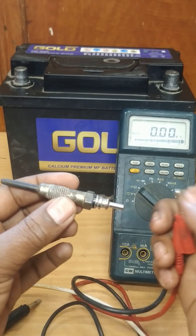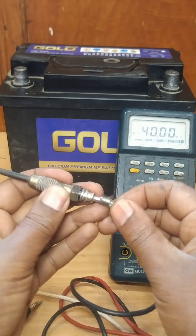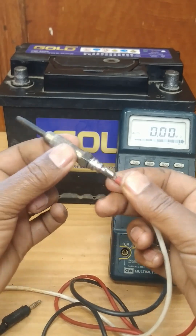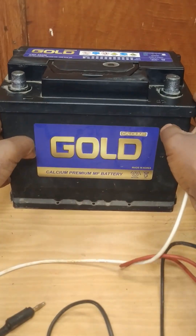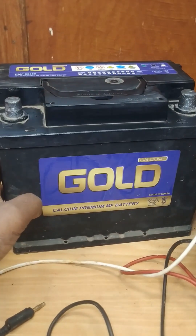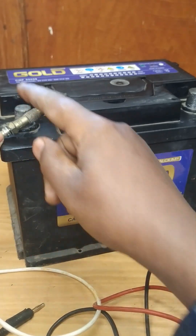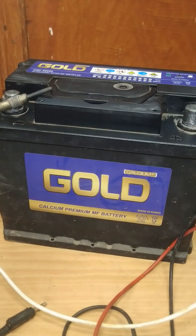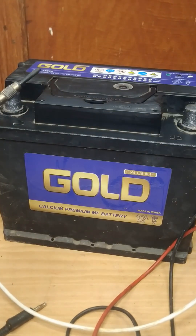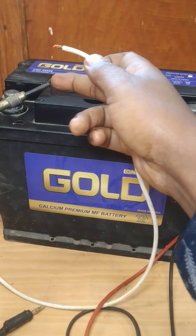The other method of testing is by simply placing it on the battery. Connect the positive terminal to the battery positive, and place the body end on the battery negative. In approximately up to 10 seconds it should glow — look at the tip of the glow plug.